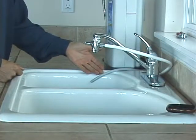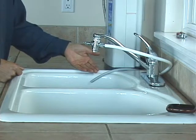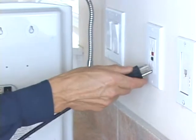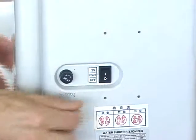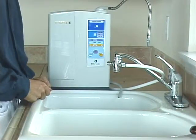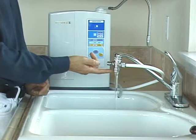The gray hose simply needs to lay in the sink — choose a length convenient for capturing the acid water for its many uses. Now let's plug in and power up. Remember the three-prong plug goes into a three-pronged outlet, ideally a GFI outlet. Once it's plugged in, flip the on/off power switch up. Now let's learn how to use the machine. Turn the water on at the tap to a nice easy flow so water is coming out of the faucet.